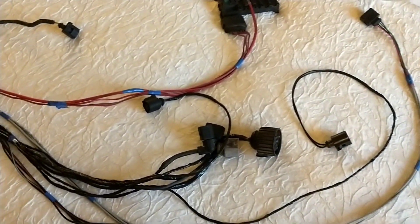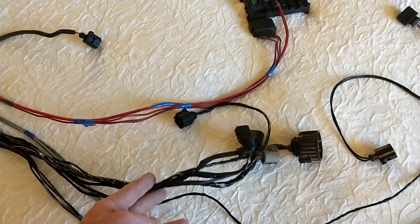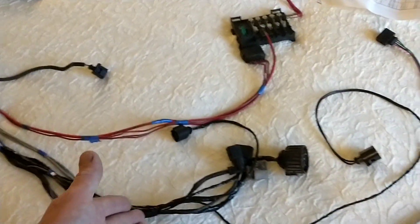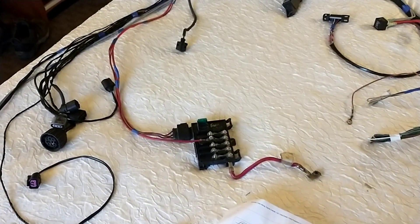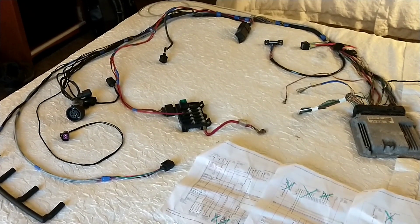That is really everything you need to know. If you do need to cut any wires and don't get them out in one piece, all of these are on the schematic — you just have to jumper between the ECU and whatever plug you're connecting to. It's all laid out right there for you. Hopefully that helps you guys out, and thanks for watching.